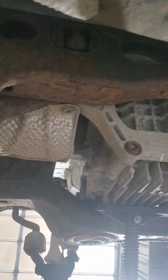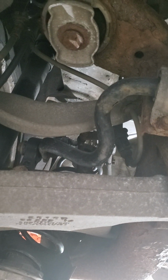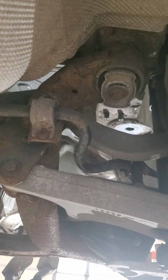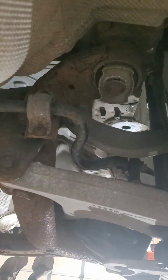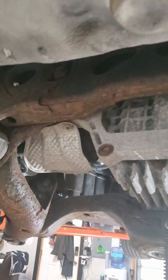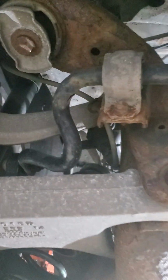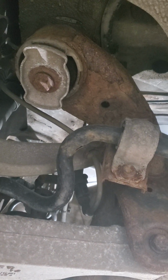Of course, you want to make sure that you get that fuel tank emptied before you attempt to remove it, because that tank is big and awkward, even when it's empty. So you definitely don't want that extra weight in there, causing yourself a big unnecessary wrestling match. So yeah, that's the deal.